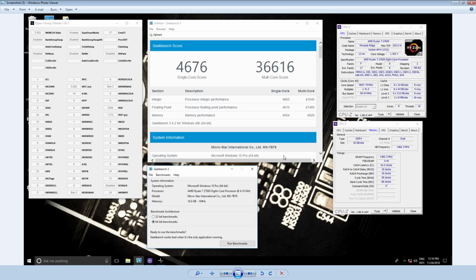And that's actually a pretty common spec for a lot of memory kits these days. You can get 3200 CL16, 18, 18, and you can get 3000 16, 18, 18. You can also get 3000 15, 17, 17. So this is not a super special XMP profile or anything like that. It's relatively common, and this is the kind of performance it spits out. I've not adjusted anything. This is just load up the XMP profile and go with it. And that's also why it went to 2933 instead of 3000. But again, that's just what the motherboard decided to pick it up as.